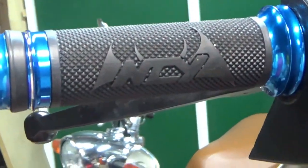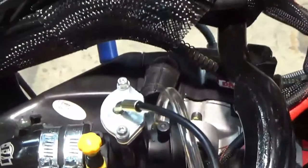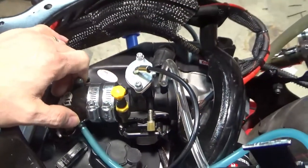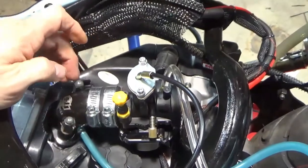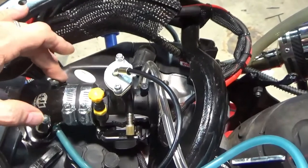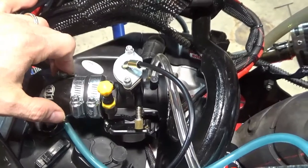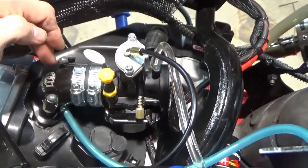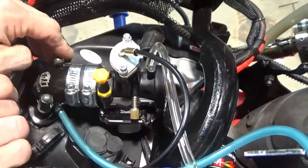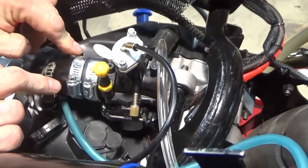So we're going to go ahead and look at the carburetor here. Now, I didn't want to bore everybody with running a cable up and over, but I went through the last video and showed you a couple things. What I ended up finding is the best intake manifold happened to still be the Naraku, and the reason was the other ones kind of sit higher. They have a different profile, the NCY, non-EGR and EGR. So I stuck with the Naraku.